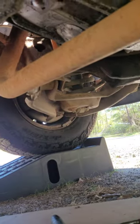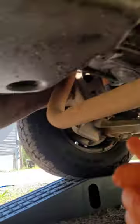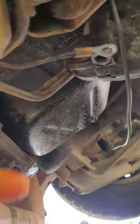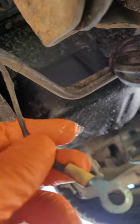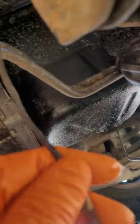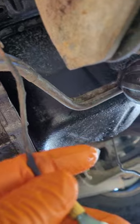All right y'all, we're back up under the truck again. Just got back from the parts store. Here's the original wire — that could have been the right size, but anyways I had 16 gauge a while ago, might have been 14. That wire right there — I think that's what happened, that's why my solenoid is not getting proper power, possibly.